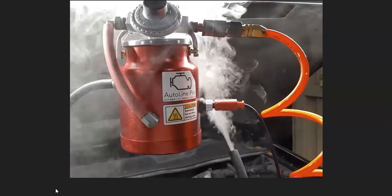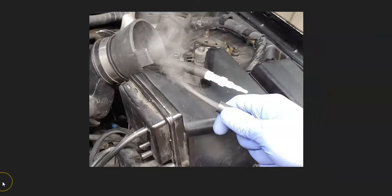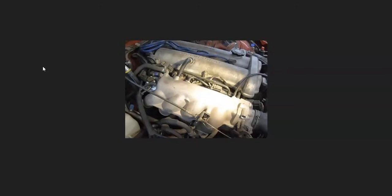Another thing that could cause this problem is a vacuum leak — a hose that has come off or a gasket leak on the engine. One method to find a vacuum leak is to start the vehicle and spray fluid where you suspect the leak; if the engine idle changes, that's the leak location. Another method is the smoke machine method — you feed smoke into the intake and wherever smoke comes out, that's where the leak is. Also check all hoses and the PCV valve, which is a very common leak point.